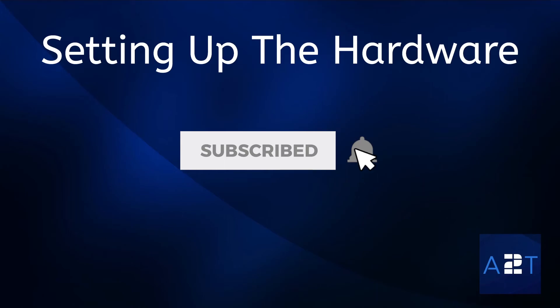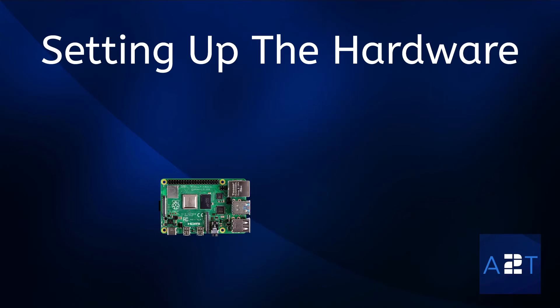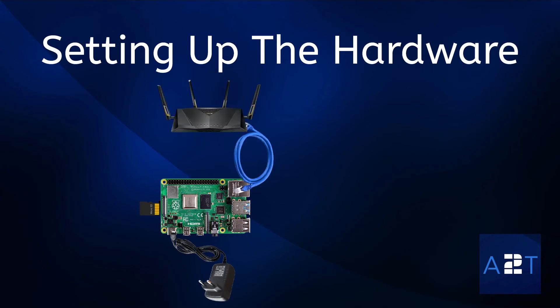Now that you have all the hardware, I'm going to show you how to put it together. Take your Raspberry Pi — the SD card goes into the slot at the back. The power supply connects into the USB-C port, and the Ethernet cable connects directly to your router. You'll also need a mains-powered USB 3.0 hub which should have enough power for your hard drive. Optionally, connect an SSD drive with the adapter to the USB 3.0 port, and then connect a USB storage device to store your data on.